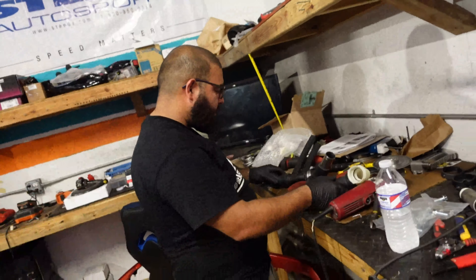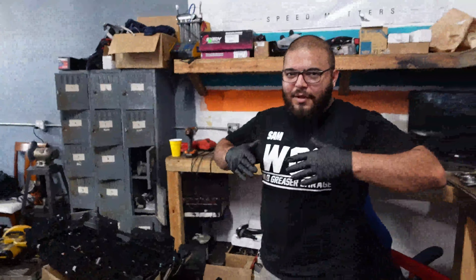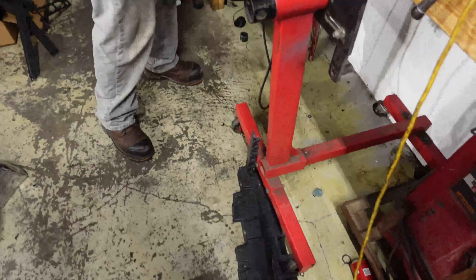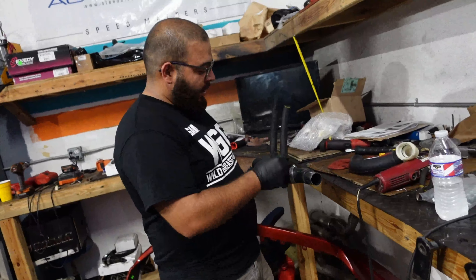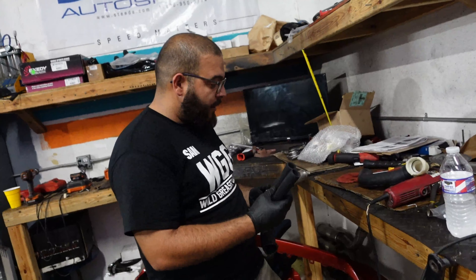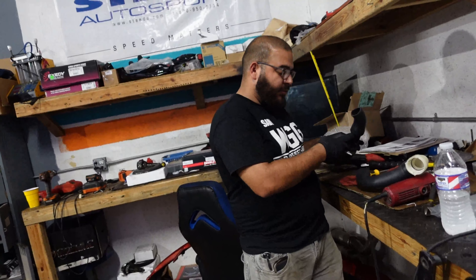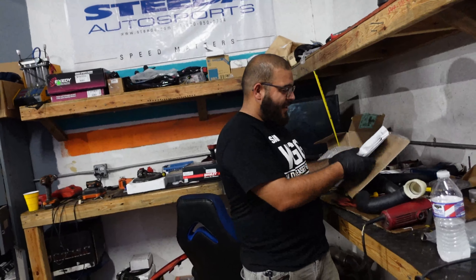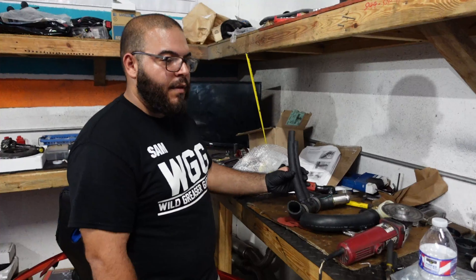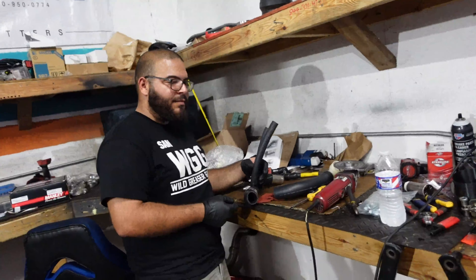So Sam, what's the progress so far? This piece right here — I cut off the shutters. It had a little actuator motor that would shut the airflow through the grille. All that got cut off to make space for the intercooler. Now I'm modifying the hose assembly — I have to cut the original hose and make two elbows out of it. The kit supplies new hoses for the intercooler. The original thermostat housing doesn't get used — the kit comes with a 90-degree aftermarket one.